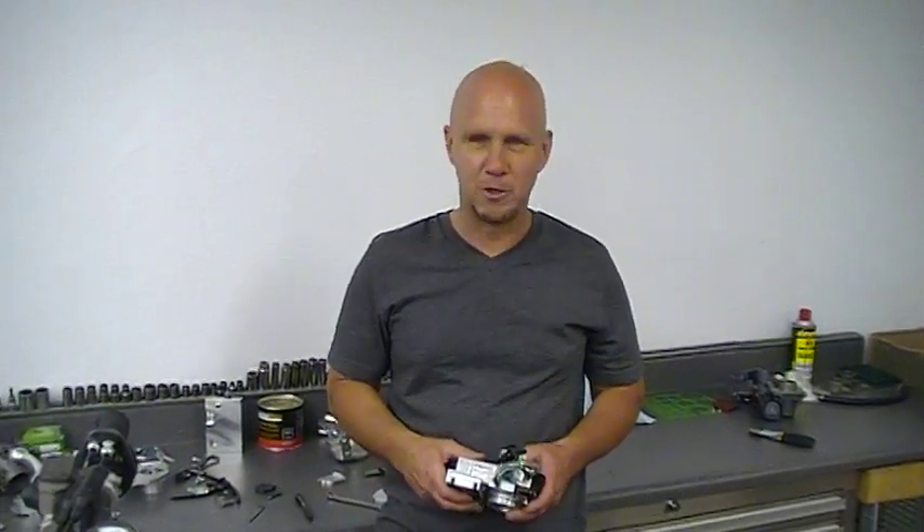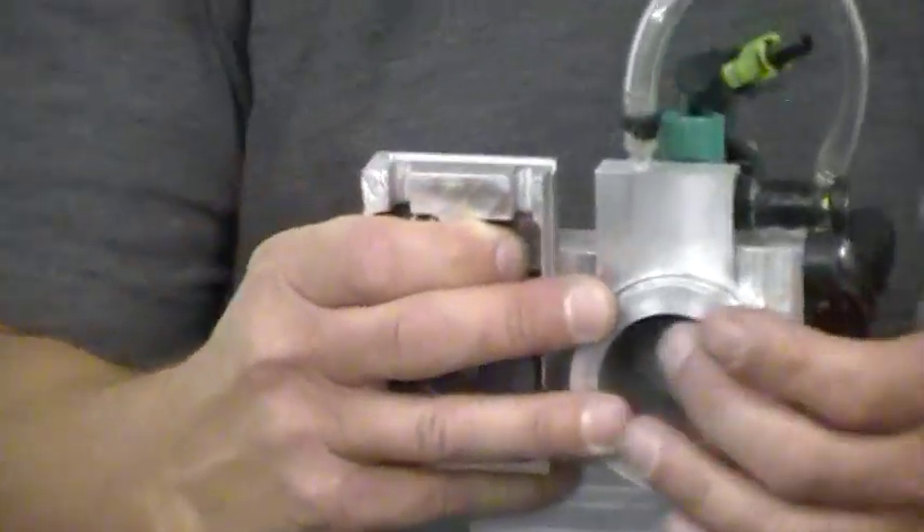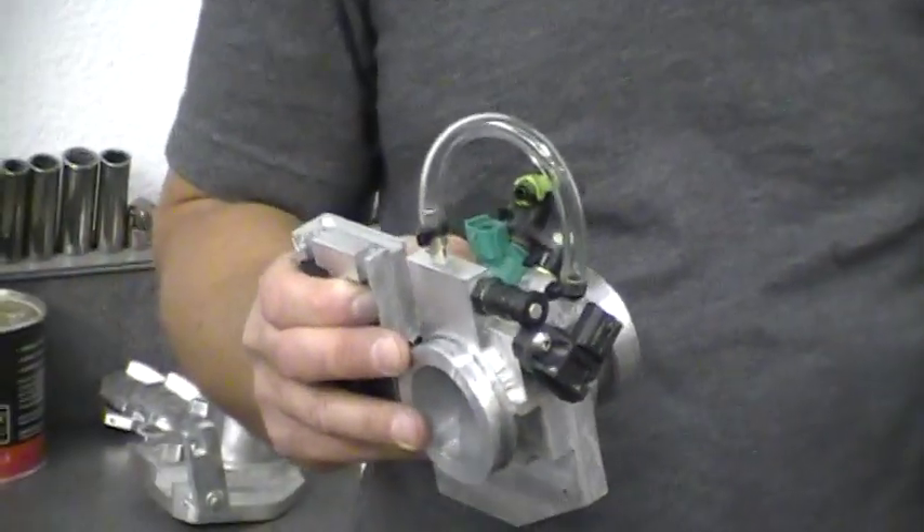It moves so much air that it's still a bit abrupt, so we had to dumb it down just a little bit. The power's unreal. The injector's back on top, exactly where it should be. The map sensor's in a brilliant location with a very short amount of travel — it responds instantaneously.